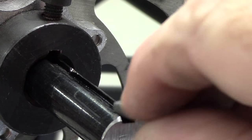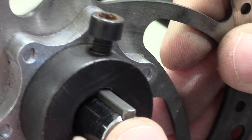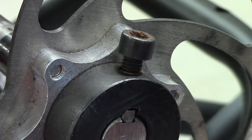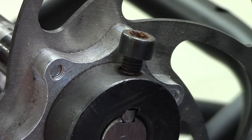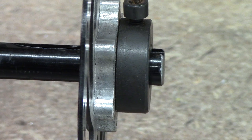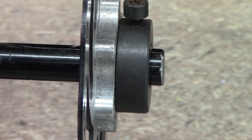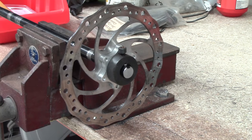The correct position for the key in the keyway needs to be flush with the end of the collar, so the key needs to be all the way into the collar for it to work correctly. Here I'm tightening the bolt down and you'll see just how strong and solid everything is as we try to move the disc. If it's tightened in the correct position it is rock solid.